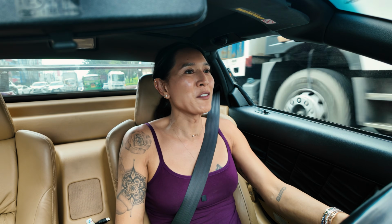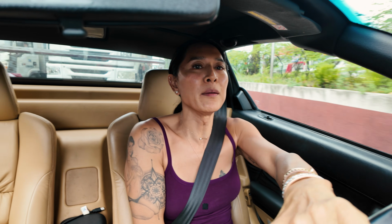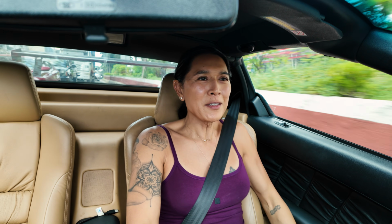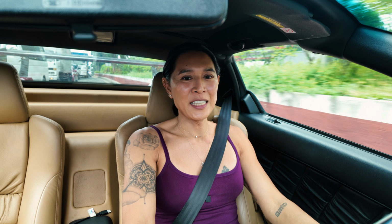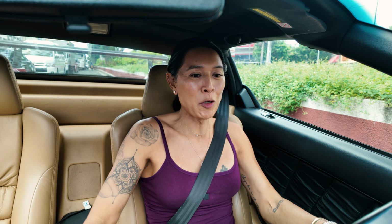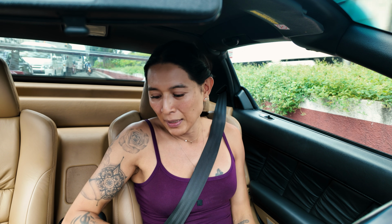First maiden test drive. Oh wow, car sounds so much better, literally 100 times better than when we had the first MagnaFlow exhaust. I am getting used to the driving position again. It's been literally almost a year since I've driven the NSX. I need to change the steering wheel, I need to change the head unit. At least the air conditioner is nice and cold. So far temperature looks okay. Actually the voltage looks okay, 13.1 at idle.